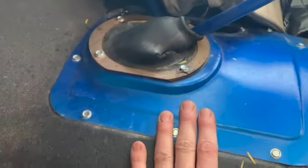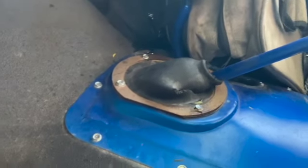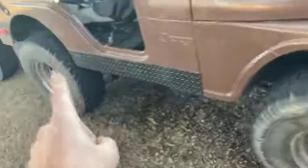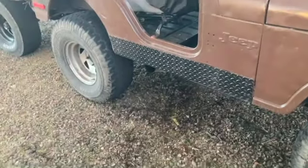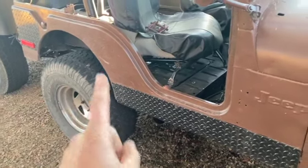This one, you can't — this is all you get. That's it. What can you do with that? All of these second generation CJs came with a Dana 44 in the rear — a centered 44 — and a Dana 30 in the front. These centered 44s are awesome. You can put 350 horsepower behind one of these with 33s or 35s, do burnouts every day after breakfast. Not gonna hurt it. These things are really, really tough. I've never broken a Dana 44 rear, ever.